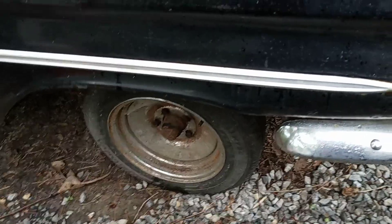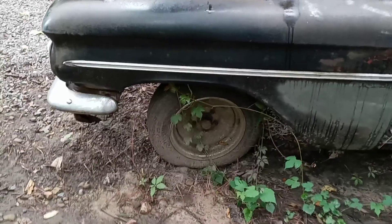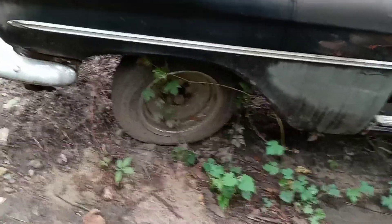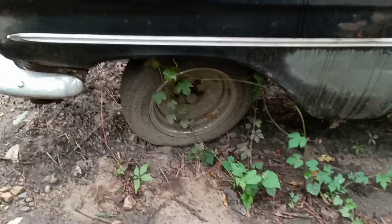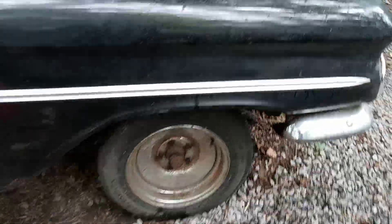I've already priced the ball joints. I'd like to do all the bushings, the ball joints, and get a pair of coil springs for the front and go from there. I'm hoping the drums will turn but I'm not sure — I'm not going to make the same mistake I did on my Edsel where I screwed up the drums. The drums and hubs are riveted together on this — you can grind the rivets off and separate them, but we're not going to do that if they'll turn. If not, we'll come up with something better.